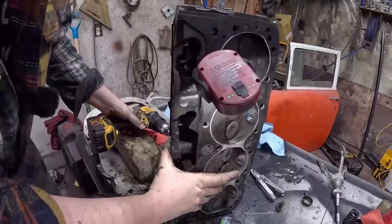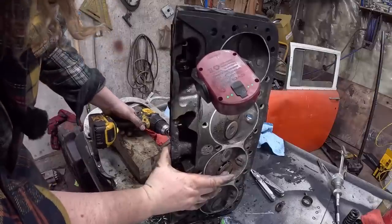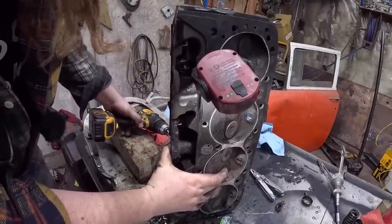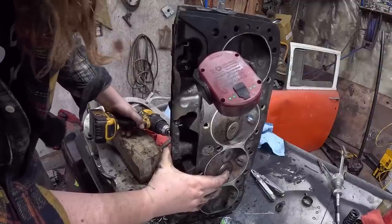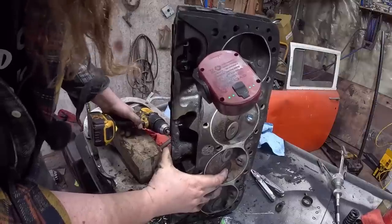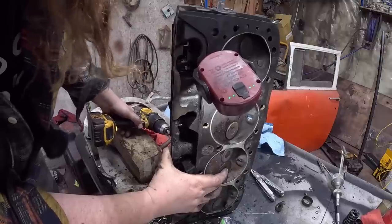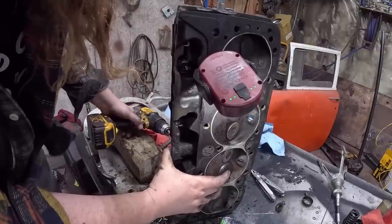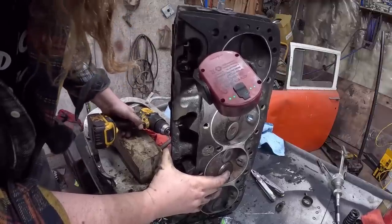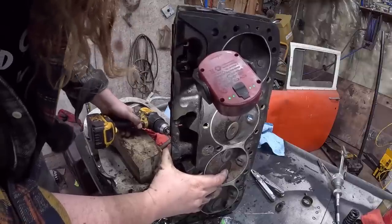And what you're going to want to do is turn the drill on, then use your finger to kind of push it in. You're basically sanding the two pieces together. Lapping. I always go on the slow side because I figure it's meant to be done by hand. So, carry on. Now, intake valves are a little thinner than exhaust valves. Just keep that in mind. But pretty simple. So we'll do this a little bit. Take it out after and it should be good enough.